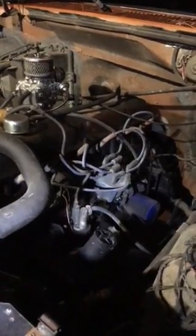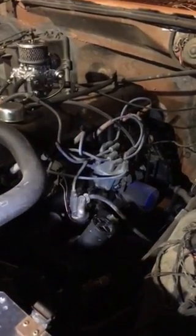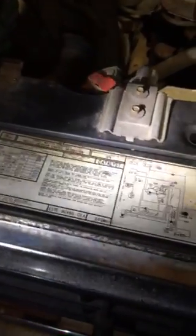This video is about the timing for a 1981 Ford Bronco, but applies to any of the inline six 4.9 liter engines. The timing spec is written right here on this document taped here — it's six degrees before top dead center.